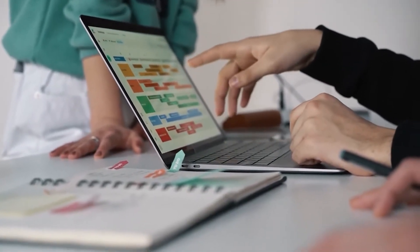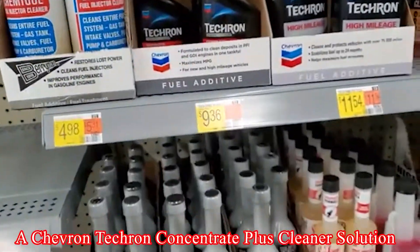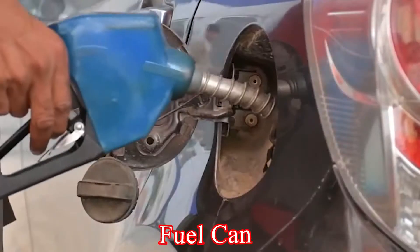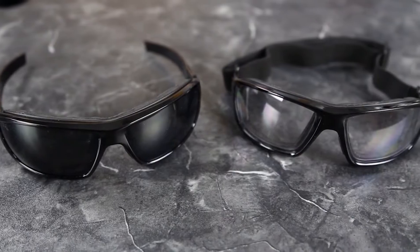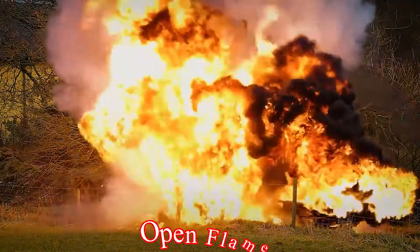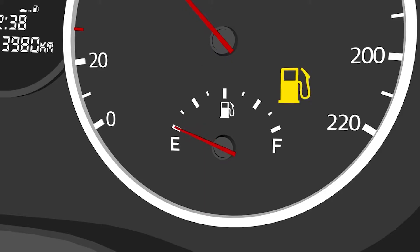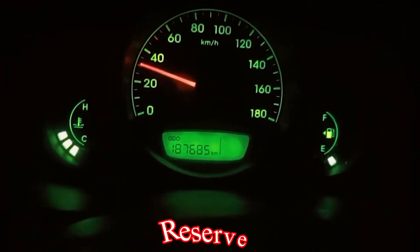Here is how to use the Chevron Techron Concentrate Plus to clean your fuel injector. You will need the Chevron Techron Concentrate Plus cleaner solution, a funnel, a gas station or fuel can if topping off at home, and gloves and safety glasses are recommended. Before you begin, note that fuel system cleaners are flammable liquids, so avoid sparks or applying the cleaner near open flame. First, check your gas level. Ideally, your car should be near empty or less than half a tank before adding the cleaner — let your gas be on reserve if possible. This ensures the cleaner gets a good concentration in the fuel.